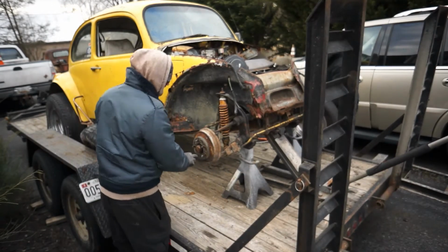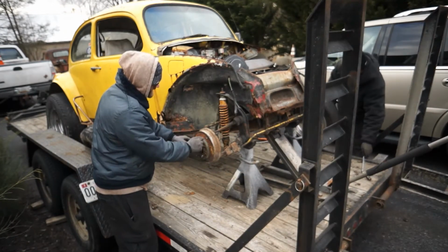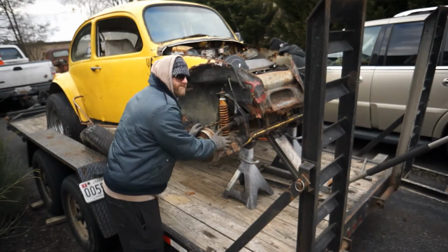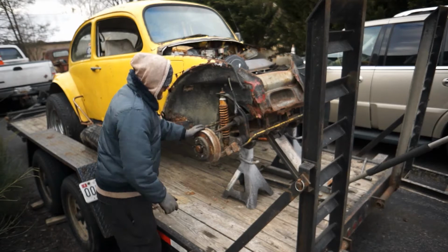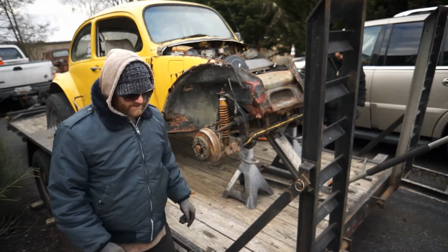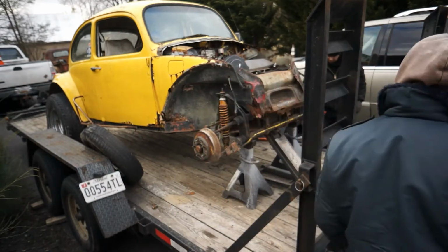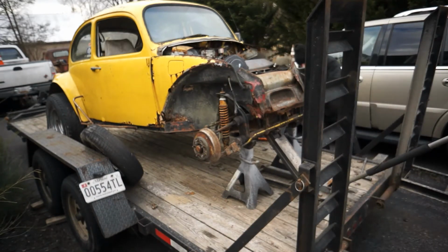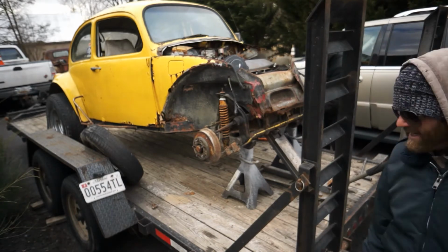Pop these caps off, and that spindle nut's back there. Once we take that pin out and back that nut off, technically, in theory, these drums should come off of here. And you can see they're just seized on there. So, which side do you want to work on first? Yeah. Let's go ahead and pop these bearing caps off over here.